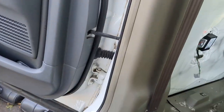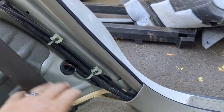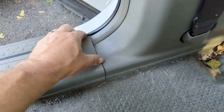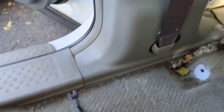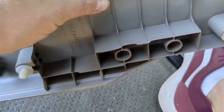A lot of this can be done just with your hand. First and foremost, at the back door, you're gonna take off the sill plate here. The back's already removed, but just imagine that it's not. You're gonna get your hand underneath it, or your panel popper. You can come at it here and pop that up. Three compression plastic clips — one, two, three.